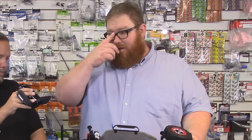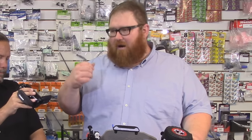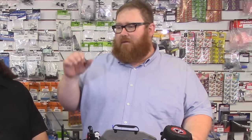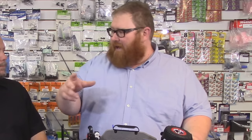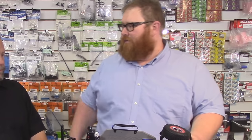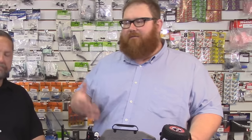The other purpose it serves is it can help keep your car from wheelying, making your car more controllable. You set it up a little loose so when you accelerate, the slipper clutch slips instead of the tires, your car goes straight, and then once it's rolling it's already under control. Those are basically the two functions the slipper clutch serves.